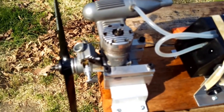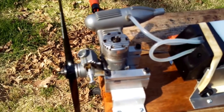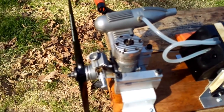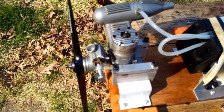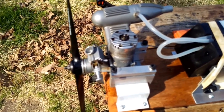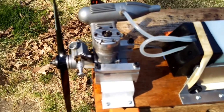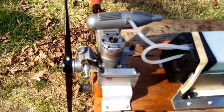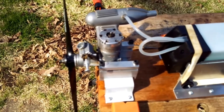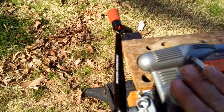It's a Dykes style ring, so the ring is on top of the piston. You get your compression from the gas throwing the ring out as it compresses, and you build power. What else? It's a steel liner, so it does make doing rebuilds easy. And again, I did run it just prior to this a few hours ago, just to see if it would run. Surprisingly, it started on the second flip. I couldn't believe it. I did run this thing just a few seconds ago.